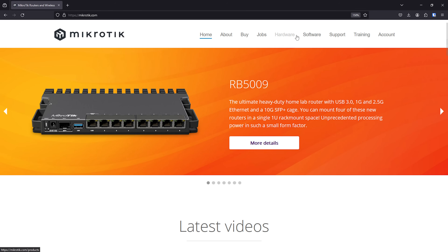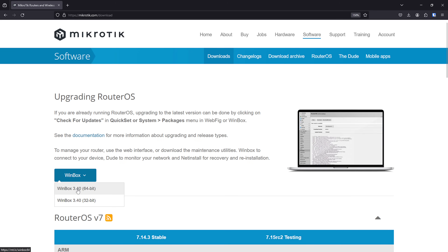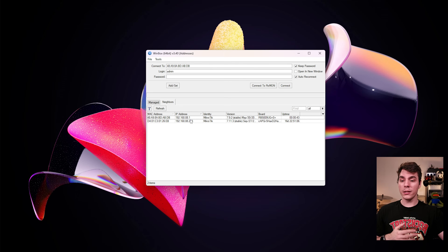Getting back to my desktop, we can manage our router either via the web UI, via SSH, or via Winbox. I'm not familiar enough with the MikroTik CLI to go for SSH just yet, so I'll just use Winbox — it's a program you can download from the MikroTik site to help you manage your device. We can now connect to our MikroTik router by opening up Winbox and then waiting for our device to automatically discover our router. We can connect using the default username of admin and then an empty password.